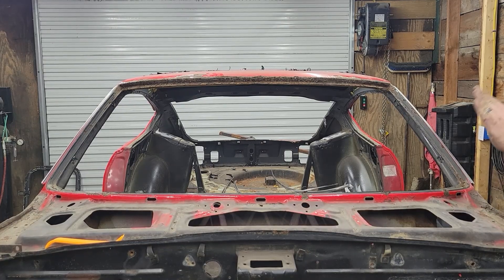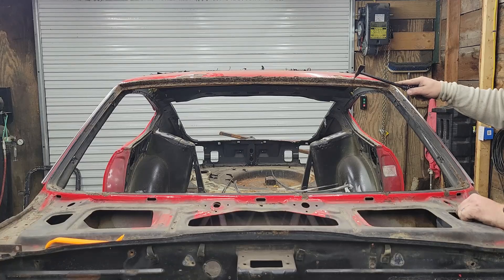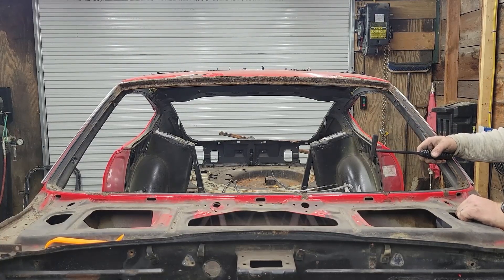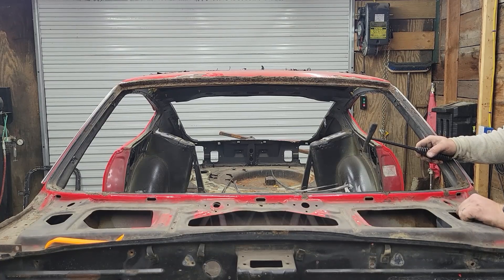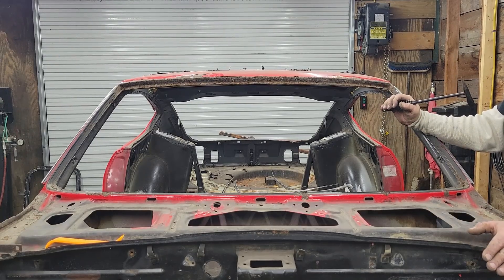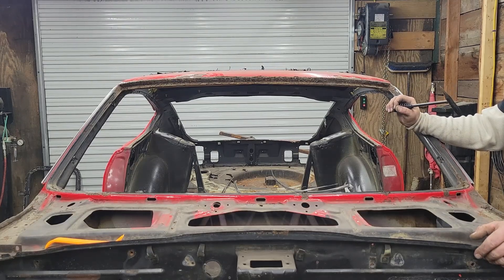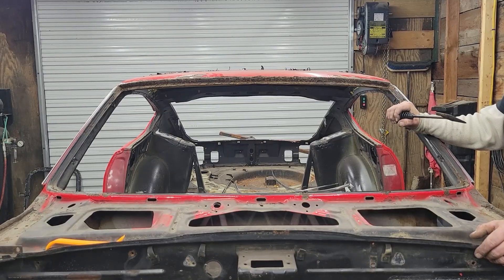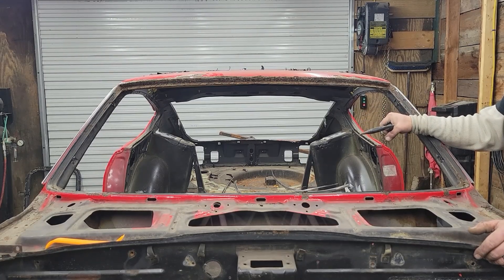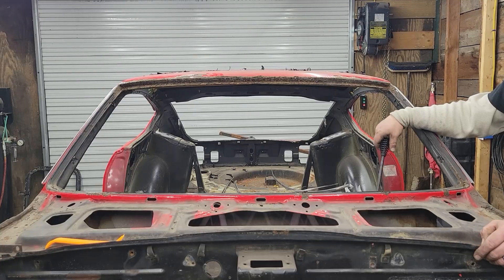I'm happy about that. It looks worse than I was anticipating — water has clearly been getting in underneath this top part of the seal for a long time. However, I don't believe we're going to have to do anything besides just clean it up and put some paint on it. I'm very happy about that. So if you have to take your windshield out and you're doing a restoration project on a Datsun 280Z — and probably any of these old Datsuns are the same — it's really not that bad. I was way more nervous about taking that out than I needed to be. As long as you're patient and don't try to flex that windshield too much when you're pushing it out, and you cut all the rubber off, it'll come out. Don't be too scared about it.